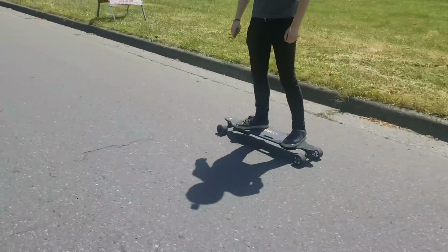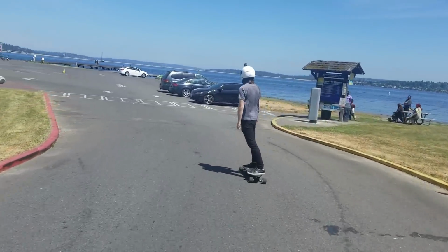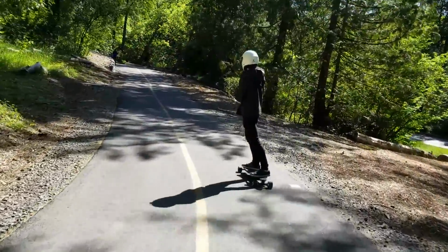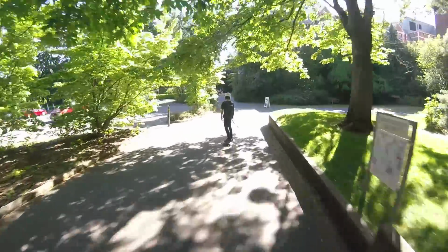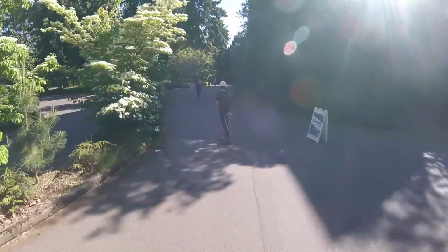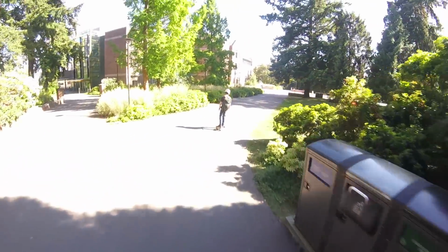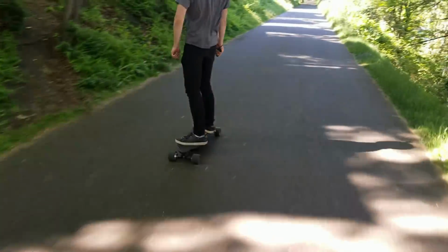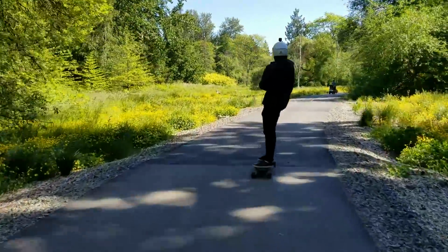Meepo has attempted to mitigate these issues by aggressively filtering control input in lower performance riding modes, but this crude palliative introduces ridiculous control latency, reduces peak torque, and does nothing to fix the jerky brakes. Furthermore, the Meepo 1.5 had an irritating tendency to briefly lose power after hitting bumps, which we suspect is the result of a poorly designed traction control system. This infuriating quirk persists with the version 2, and as you can see in this uphill drag race against the WowGo 2S, it can severely hinder real-world performance.